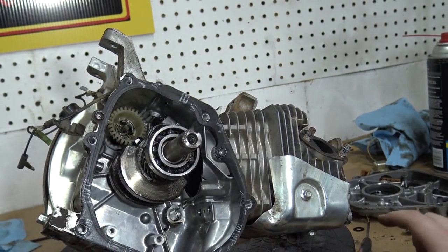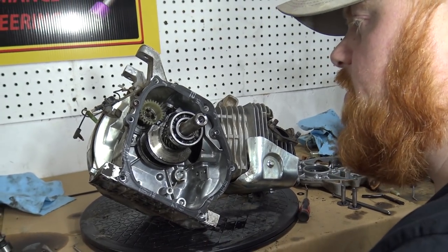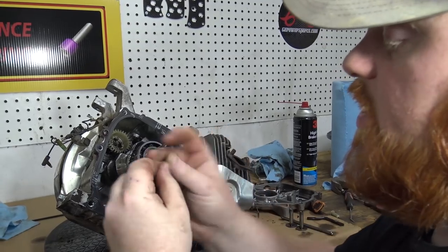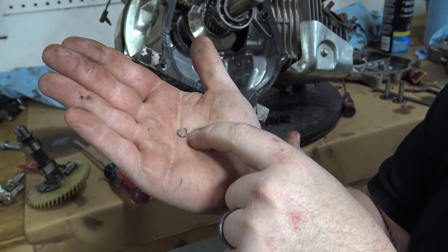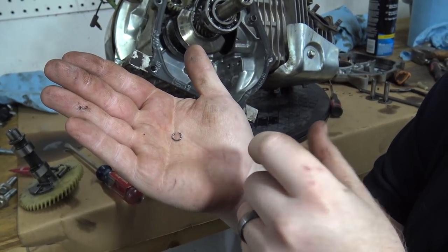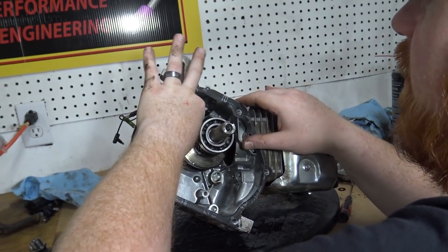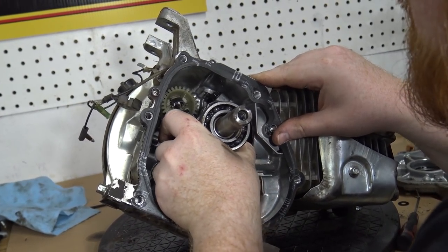hammer. I found if you put the flathead in, oop, little duck feather, on one side of the opening on this ring, you can kind of see where I did it, and hammer down on it, it kind of bends the ring and kicks one side up, and then you drag it right off. This was actually the fastest governor I've ever taken off.